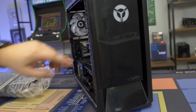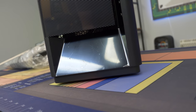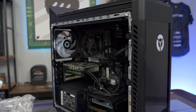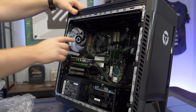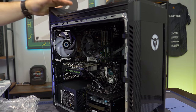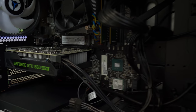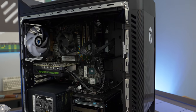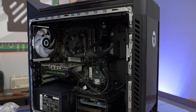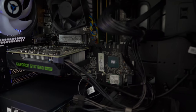The case has a little bit of a grill for intake, which is a bit better than totally closed Dell cases we've seen. I'll need to test if the i5 is perfectly fine with this cooler — it looks very similar to an Intel stock cooler. We've done plenty of i5 10th gen builds with stock coolers and they were fine. The 1660 Super is the traditional OEM version, pretty small. And you also get Wi-Fi and Bluetooth with this.